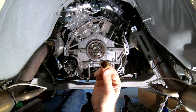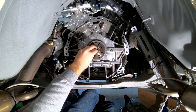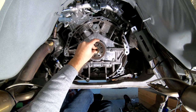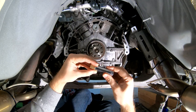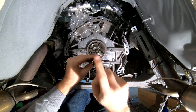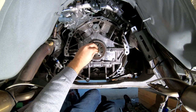With that pilot bearing out, we're going to install the new one. For that, we're just going to put it in place and then lightly tap at the edges with a hammer to try and get it seated and aligned well. I've got a little 14 millimeter socket that's just about the same size as the bearing, and I'm just going to use that to help tap it all the way in place to get it seated.